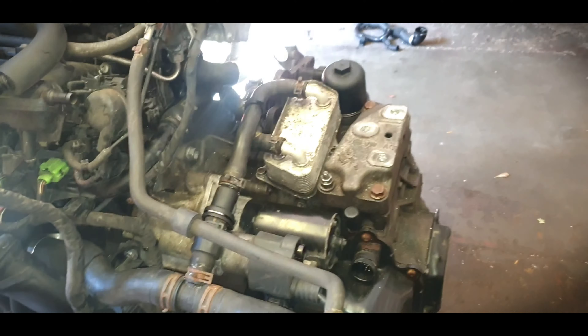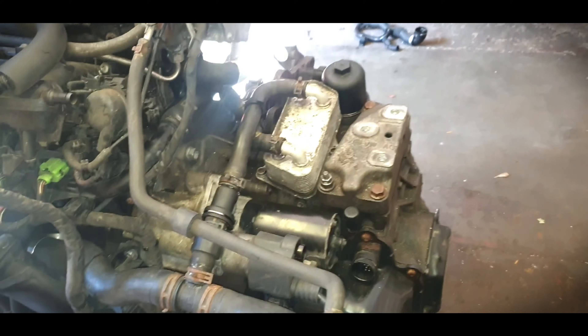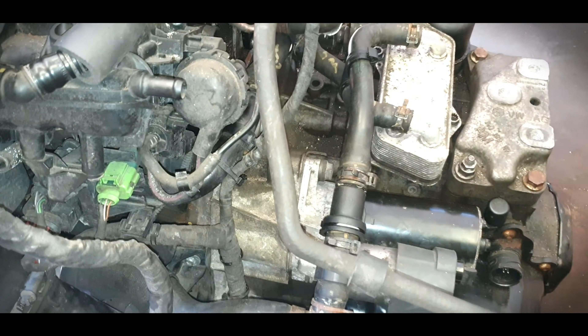So that's what we're going to do. I'm not going to be touching anything to do with the flap or the intake or anything — everything looks good. I'm going to be taking off these pipes, just cleaning out any excess oil. Basically, we're going to be trying not to touch anything because once you start touching stuff, you need to swap a lot of seals. So if it's not bad, we just leave it.